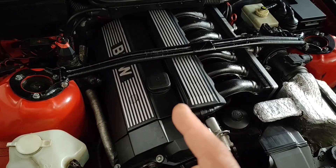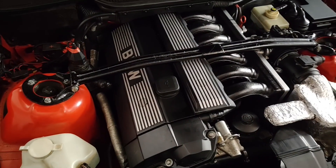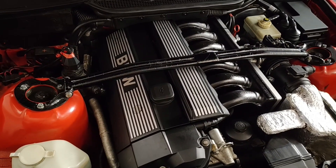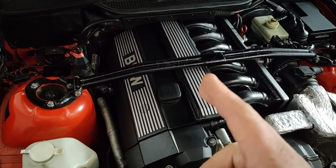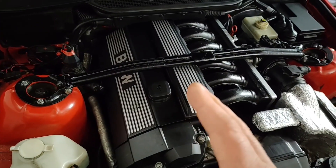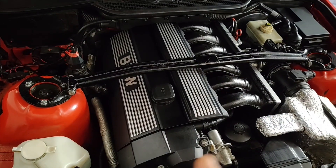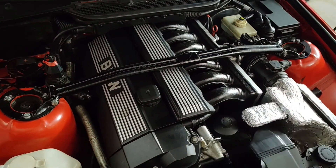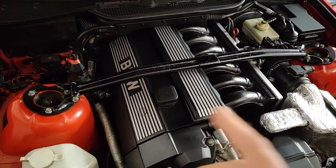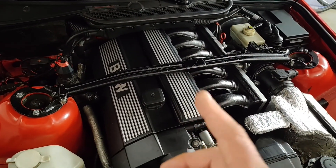Currently the vanos angle in the data logging shows about 21 degrees with VANOS activated around 46-47, so 21-22 off. I'm going to go back to straight, which is going to be around 23-24-ish vanos angle — so two to three degrees back advanced. I just want to see what it does with this manifold. Essentially I'm increasing the overlap again, hoping that scavenging effects will take place and aid cylinder fill when I advance it.